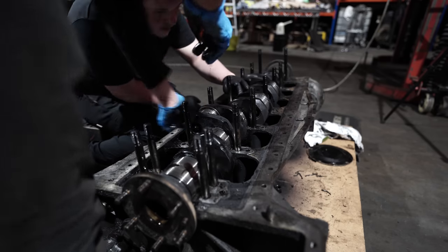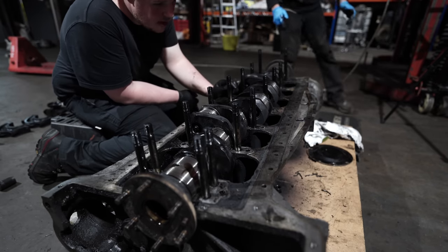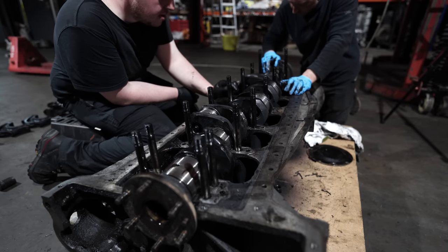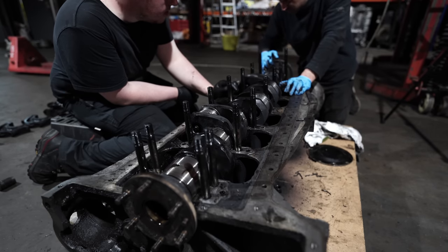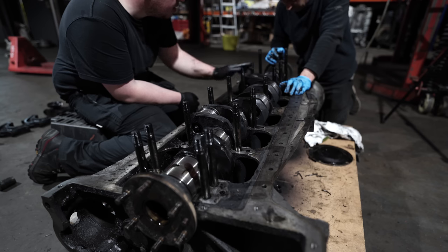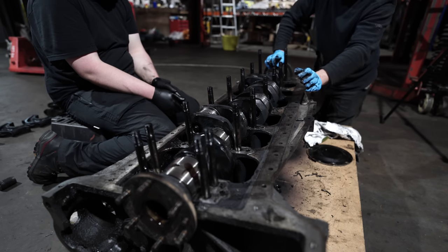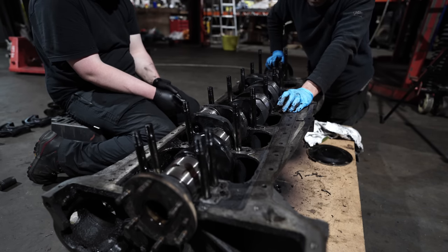Where you've got a hollow in the centre of the bearings on one and seven and on the centre as well, that's where you normally get a good indication, because if you can feel that, then your crank's well worn. And there's nothing. You can see it, but you can't feel it, can you? No. So the crank's pretty good. You just clean up the journals there, Marie, and stick it back together with a new set of bearings, probably.